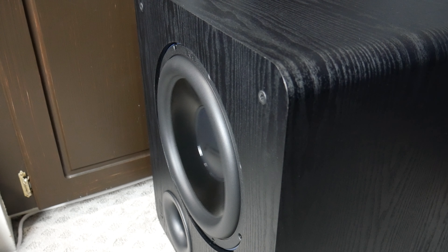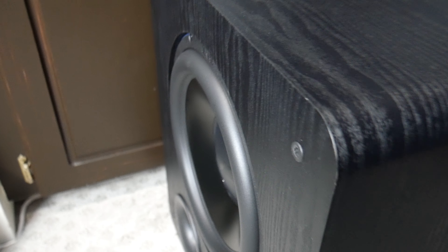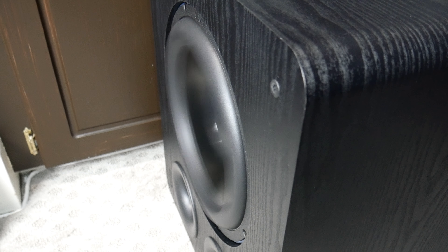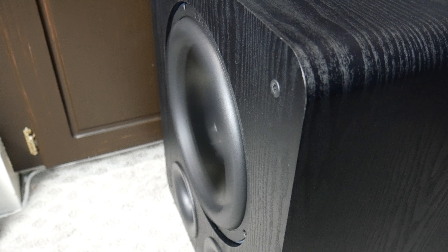Overall with the performance, I was happy with this 12-inch subwoofer. I don't think anybody will have any complaints. It's nice and tight, it's got some decent mid-bass, it has some decent rumble. As you can see from my REW video, it does get down to 16 Hz as claimed by SVS. I wasn't getting there within 3 dB of its peak, but it was a fairly flat response and I still had usable output down to 16 Hz — I believe around 100 decibels. So this subwoofer does offer you some response below 20 Hz.